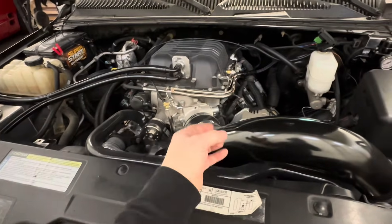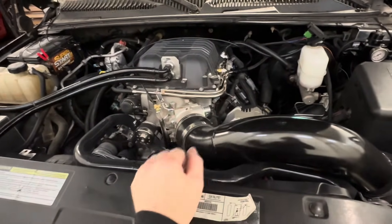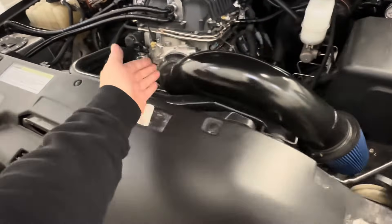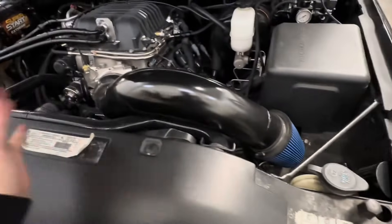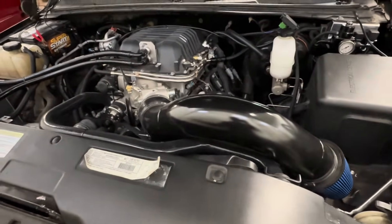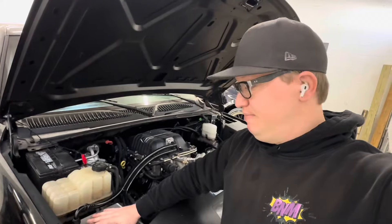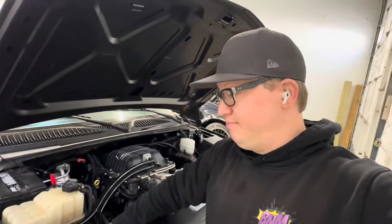That's all you really need electrically — ECU and brain control wise, that's it. I'm not running a MAF on this setup; I'm deleting that because there's really not a good straight path where air can pass through the MAF. The fuel system on this truck is basically stock — I added a regulator and a dedicated fuel pump relay. I also grabbed a generic 2.5-gallon eBay fuel cell, welded on an additional bung and a vent, a generic water pump off eBay, and a cheap 50-dollar heat exchanger off eBay — just down and dirty, plain and simple.